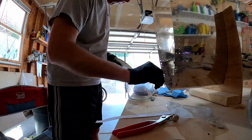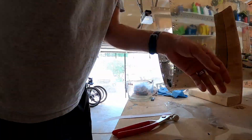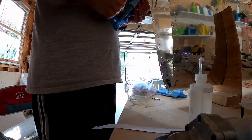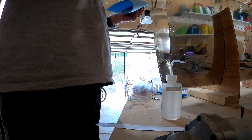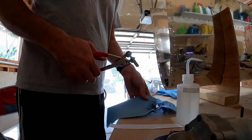I apologize for the camera angle, you can't really see it. But unlike the interior tank ribs, where you want to just sort of make sure there's a fillet around the edge, just so it's sealing the rivets in — around the nose where the space is between them — it doesn't matter because those are interior ribs. That portion fuel should be allowed to pass between them if it wants.